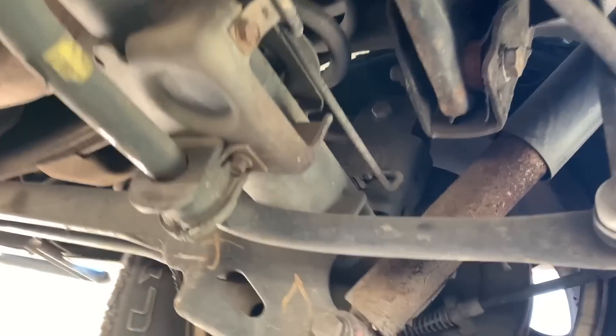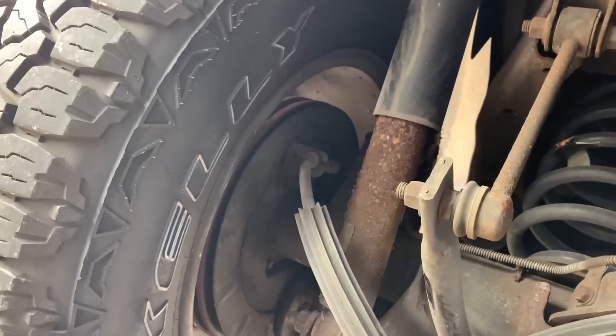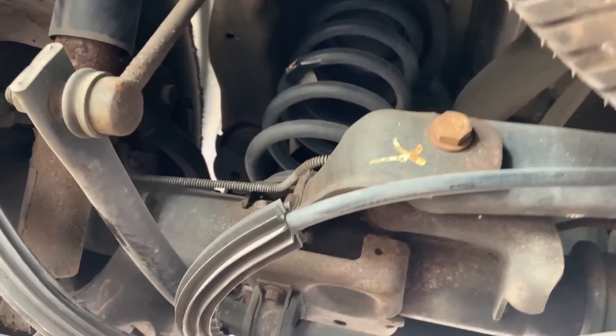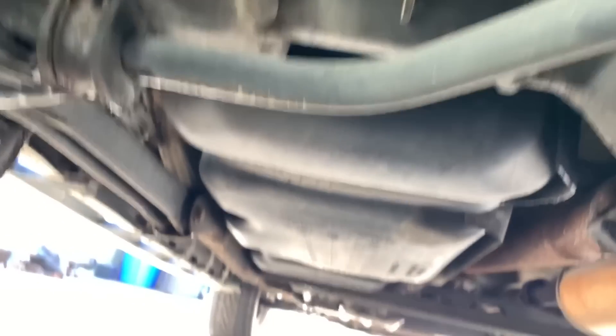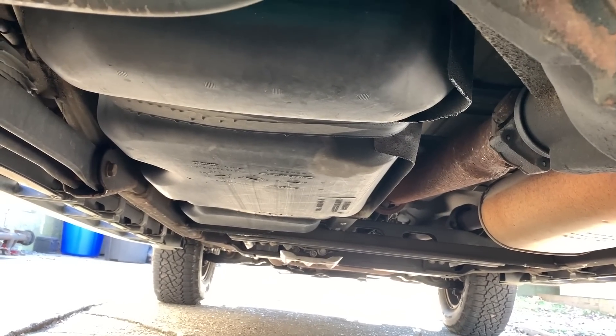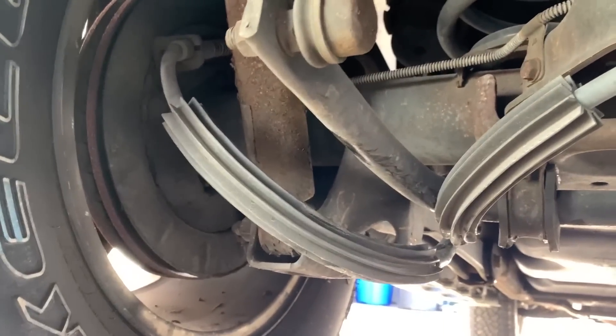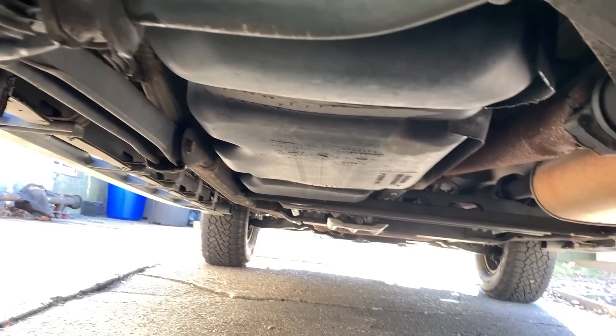With the diff taken care of, looking at the rear suspension here — once again everything looks pretty much immaculate, I don't see any major rust. The only thing I'd like to address is probably throw a new set of shocks in here; you can see they're looking pretty crusty. The links and the bushings and everything look good. The parking brake — you can see the backing plate on this side is starting to rot out a little bit, and the parking brake just doesn't work at all. It's either new hardware and shoes — the cable goes all the way down to the floor with absolutely no tension on it — something inside the hat for the rotor is screwed up at the parking brake.